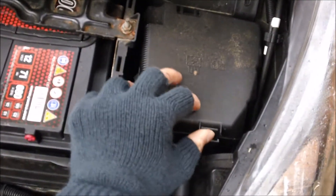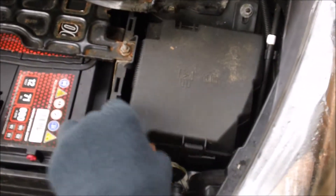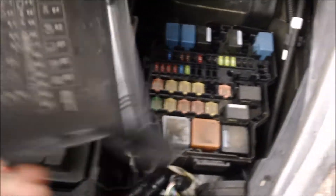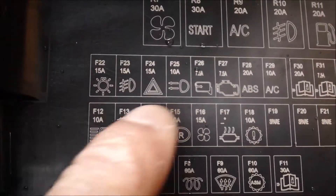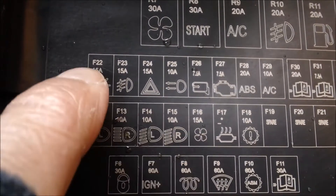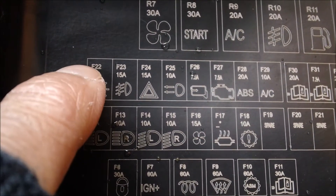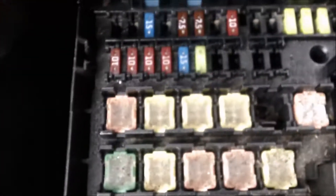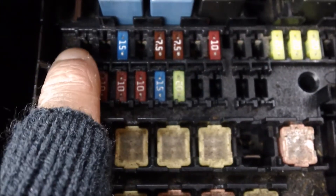For the side lights — front and rear side lights — just come to this box, push this in and lift it up. Now the thing is, on the box it tells you. It's none of these — one, two, three, four — none of them. It's this one. You want the 15 amp which is number 22. So you look there, then you look at the actual fuse box itself. Number 22 is that one.